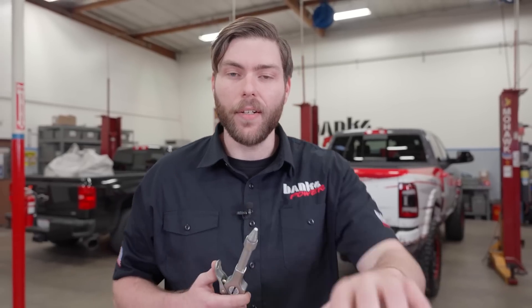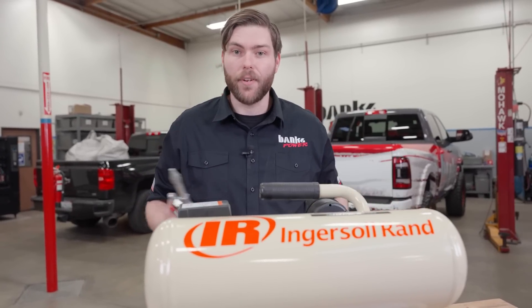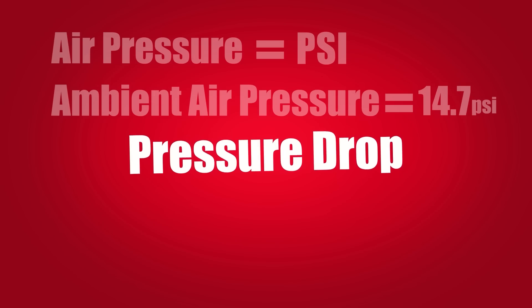When there is a difference, or a pressure differential, air wants to flow from high pressure to low pressure in order to equalize. An air gun on an air compressor blasts out air by simply opening a pathway between the high pressure tank and the low pressure ambient air. The flow bench measures this pressure differential, and since it goes from high to low, we call it a pressure drop. By measuring the pressure drop through a component, we're a step closer to knowing how that air will actually interact when installed on a vehicle.